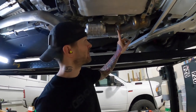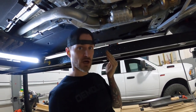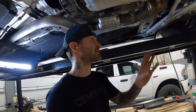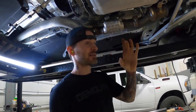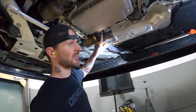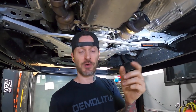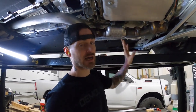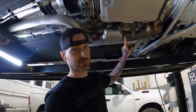This side is more of a pain in the butt because it's got a donut style clamp and these are impossible to get off - not only are they kind of crush-fitted around each other but you actually have to pull the exhaust back to separate the two sections. I don't want an exhaust system that's hard to take on and off. So I bought some three-inch clamps that are going to be a two-bolt design, but instead of having welded-in studs you just slip in a bolt and put a nut on the other side. If you ever want to remove it you just take the two apart and they're fully separated, so we can remove this section a hell of a lot easier in the future.